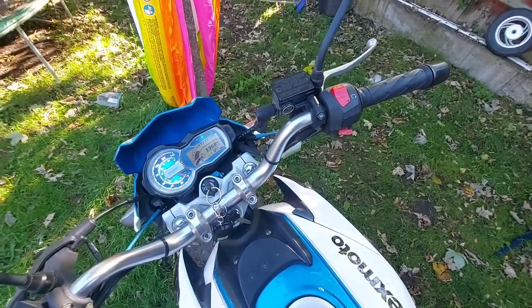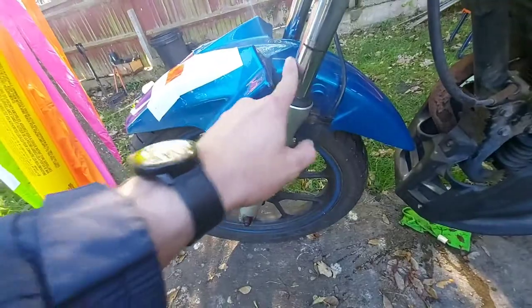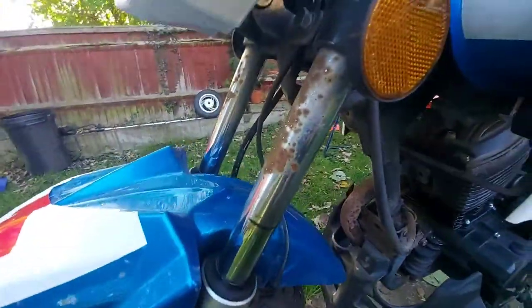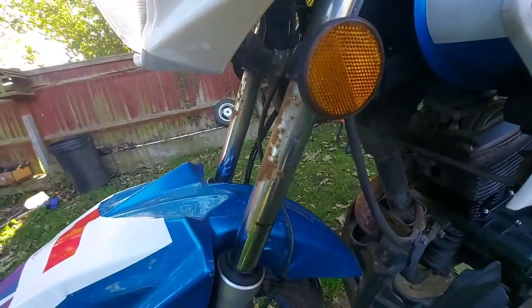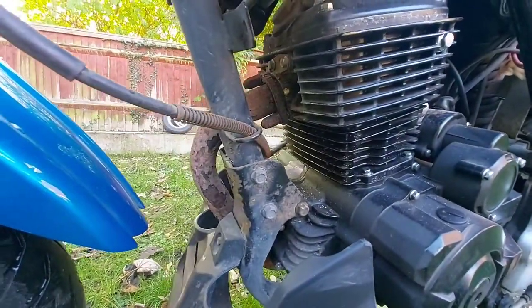She's a lovely little thing, but the back brake is definitely binding on. I'm not too sure about the front brakes — I'll have a look at those. There might be a leak there too. Look at that — that's awful, it really does need cleaning up.